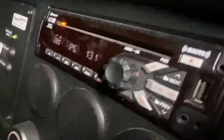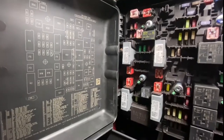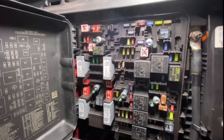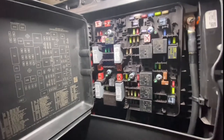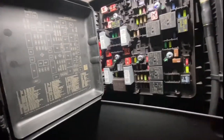The radio is on now, so we're back over here at F16. There are two fuses for this - we're going to try the first one. She came back on - power, power. That fuse is good. That's how you check it properly.